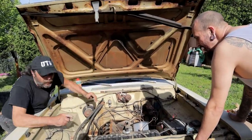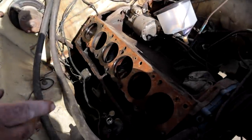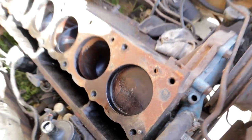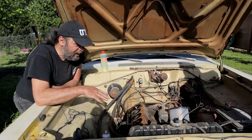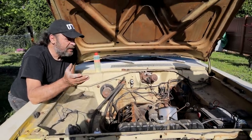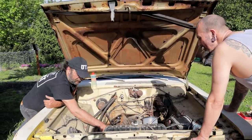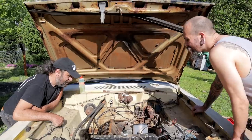So, if this cylinder won't hold liquid gasoline for any amount of time — even just a small section of it won't hold liquid gasoline — it's certainly not going to hold air. We know that cylinder is a dead player. If we put the cylinder head on and try to get it running, we know it's going to be a five-cylinder engine. There's the answer as to why it had no compression, although the second cylinder is still holding plenty of gas. It might have had a bad head gasket too, pushing compression over to the other one.